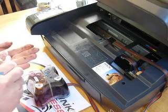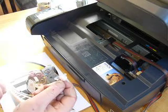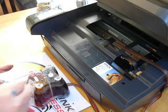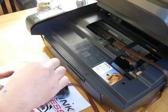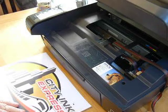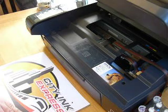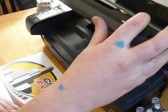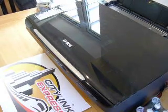Within your accessory pack there are some air filters. They have a narrow pointed end and a short fat end — they need to be inserted with the narrow pointed end towards the top. The continuous ink system is now installed. I'm going to sit this at the side of the printer; the cable is long enough to go around the back if you haven't got room at the side. So that's how you install the continuous ink system on the Epson Stylus SX200. Thank you.